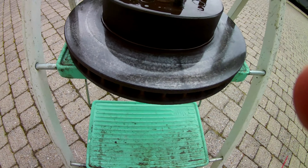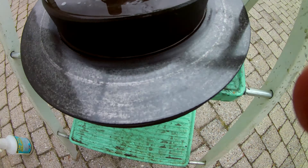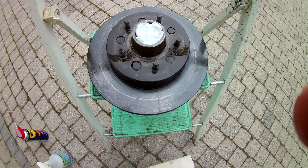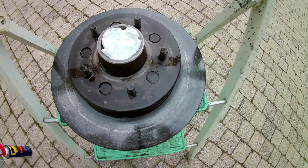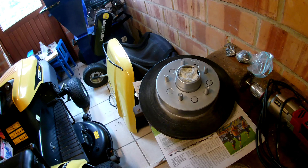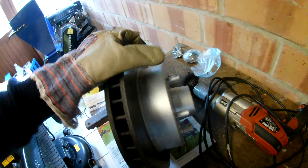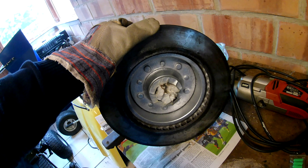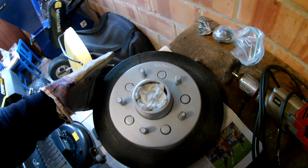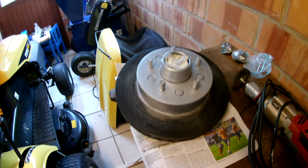We did some working with the wool by hand to do it really right. We sprayed the rusty parts with metal ready and protected the rotor with WD-40 for the time being. Now it has to soak for 30 minutes in the metal ready and then we have to clean it. I also painted the inside and the outside with silver paint for exhaust so it can stand some heat, and I'm happy with the result.